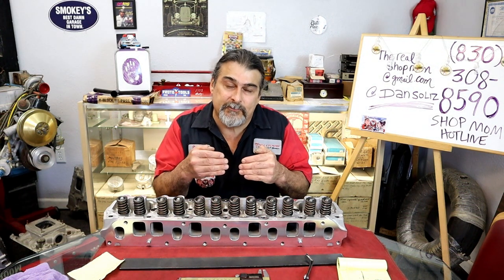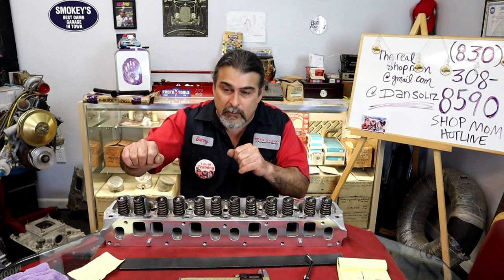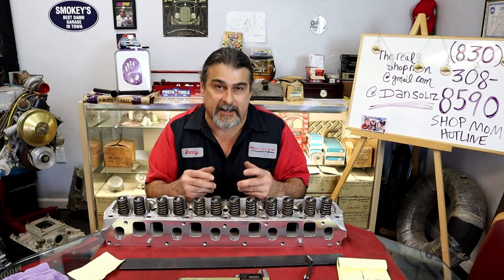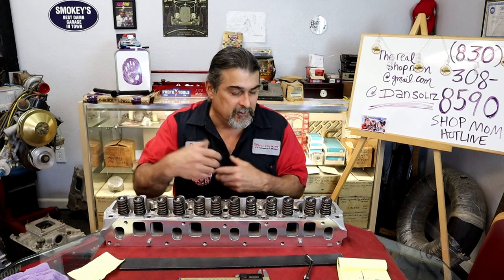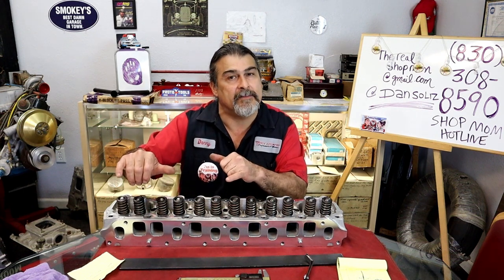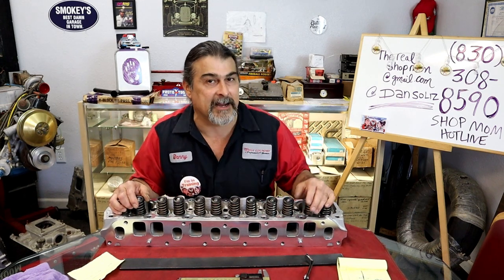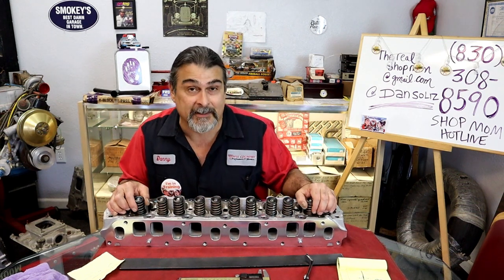You need to know just when it's about to let go. Because that's when you know, whoa, stop. It's telling you, it's screaming at you. The bolt gets spongy. It starts giving it up. Once you get to the point, it becomes like a sponge. You've stretched that bolt beyond. A lot of times you can know when you're getting there. You know the feel of it. I can't describe the way it feels in your hand. Could you describe to me the way it feels in your hand?